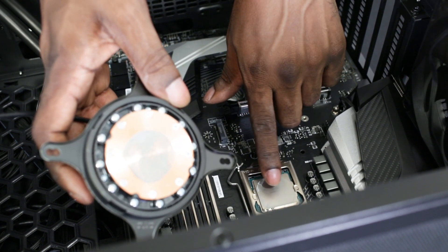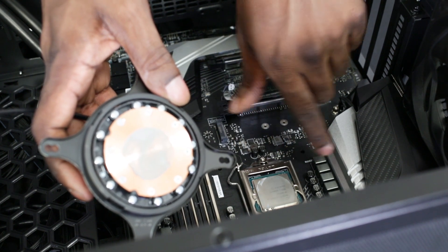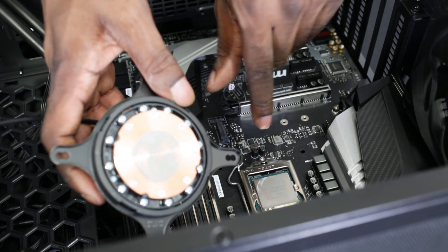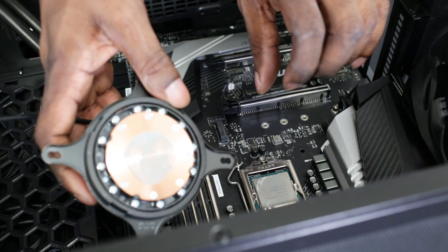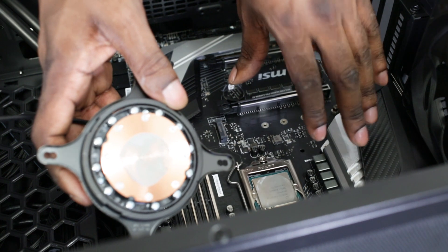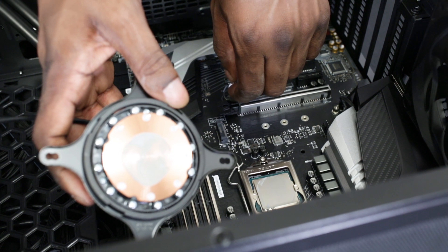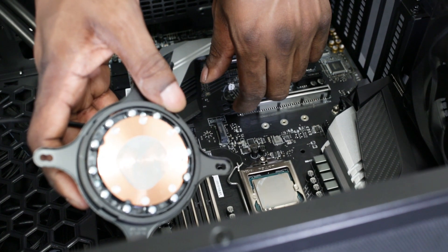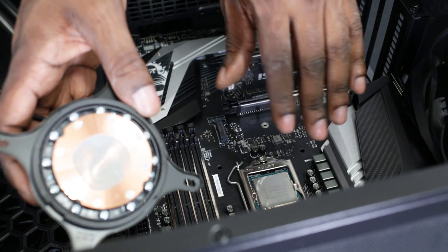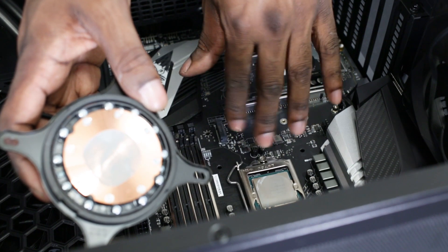You want to take it back and say it's got a little warp in the middle — that's what the warranty covers you for. If you're impatient and put the CPU in anyway, a thermal issue will start to heat up on the CPU and you won't get the proper performance. So if you buy a 9900K, you might only get the performance of like an 8600K or something like that. When you go to overclock it, it will just give you problems and you won't know what's happening.